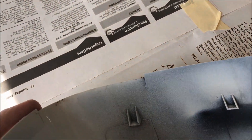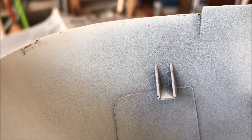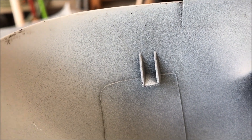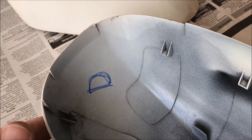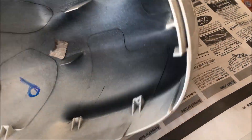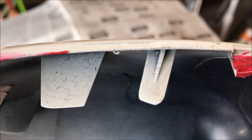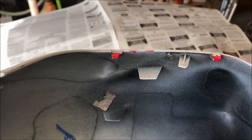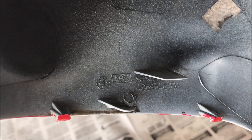The rest I'm going to call guides — they don't have any actual clipping on them, although I did push on them to release some of the mirror. The ones on the bottom are the actual clips; the rest are guides that slip into place. This one is the driver's side, and this one marked with a P is the passenger side. It's also got the clips on that side and the rest are guides, so you can see the orientation.